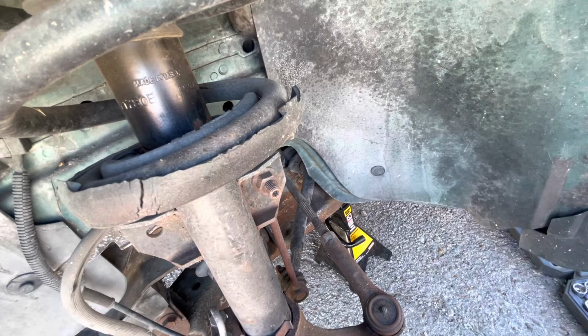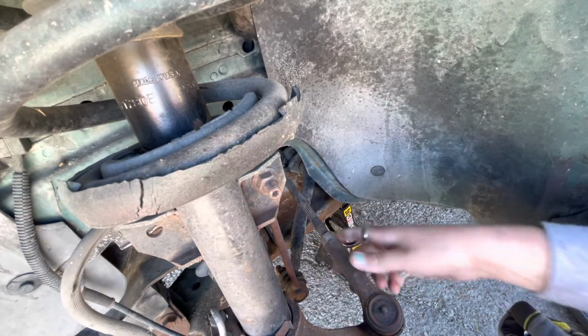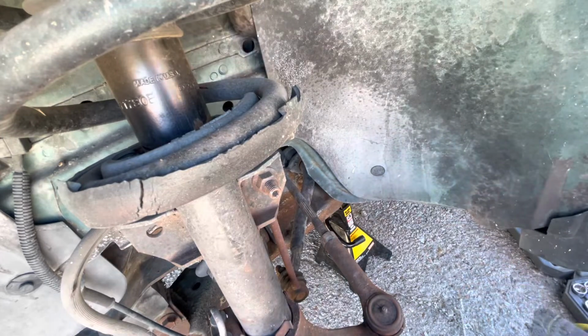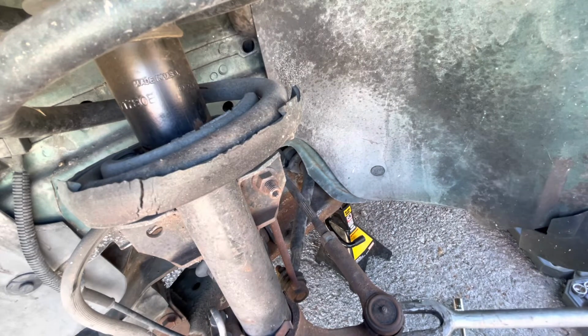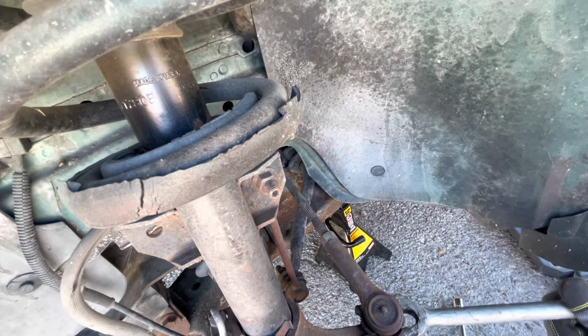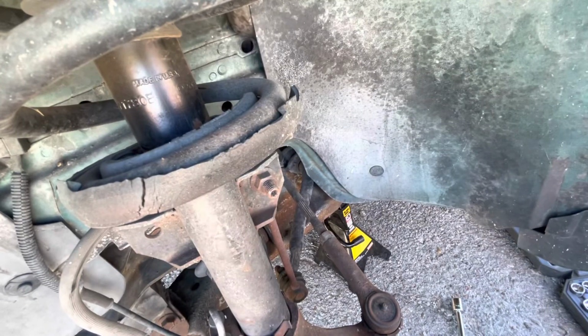So anyway, once we get that off, we're going to take this nut here. It's a jam nut, and that makes it so that nothing can back off, and it'll stay exactly where it's put. All right, so let's see what we can do here. Now, normally these pickle forks, you start beating on them, you tear these boots, and then dirt can get into the grease. So sometimes, if you can put that on there like that, and let's get old Thor over here and see what.